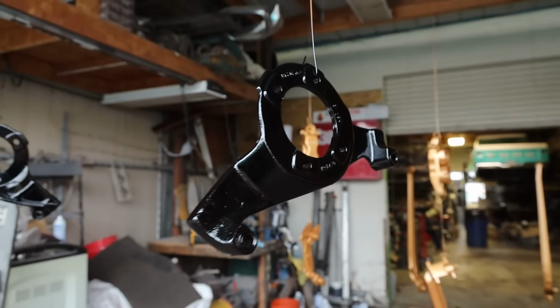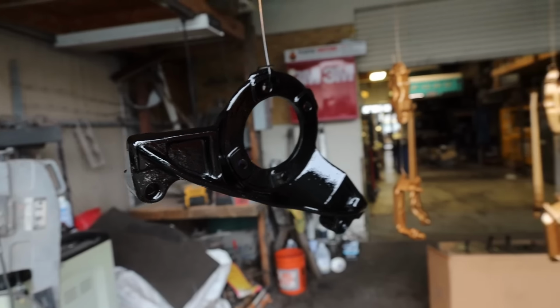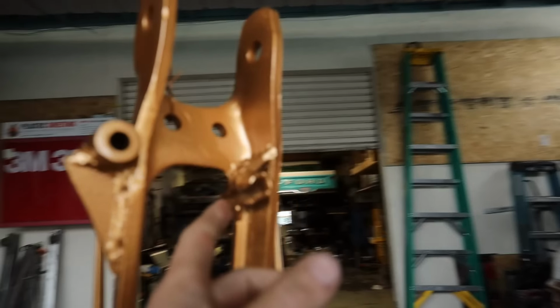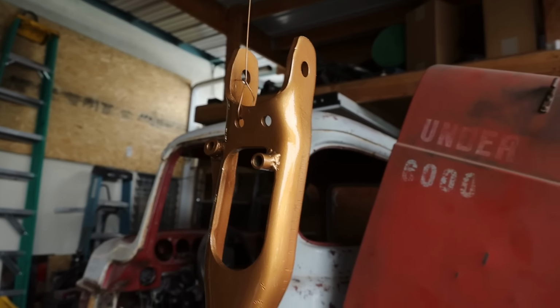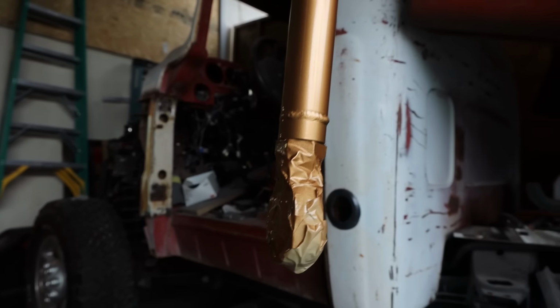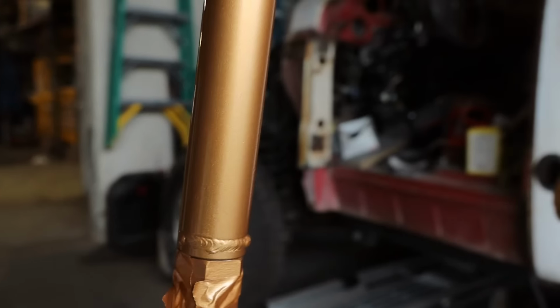This is all base coat. The nice thing about base is you can kind of use the base as its own primer, and then on stuff like this comes out really, really good. We definitely should have cleaned these up, chopped these off, but whatever, you don't want to notice it. You can barely even see up on that part, but man, this color looks sweet. Franklin's welds on the bungs look good all the way around. There we go, now you can really see that metallic.